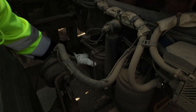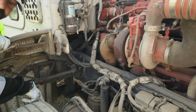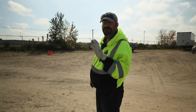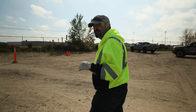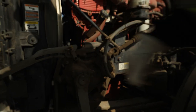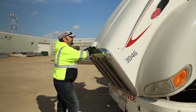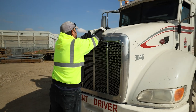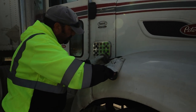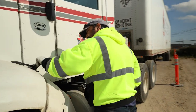I also want to check my steering control arm — looking down to see we have the castle nut and cotter pin right at the bottom. At this point we're done our underhood inspection. I'm now going to safely close and secure my hood. This particular truck has a safety hood latch so nobody can close it on you or the wind. Verifying no tools, nobody underneath — undoing the safety latch now and safely closing our hood. Latching it up properly on both sides. This completes our underhood inspection.